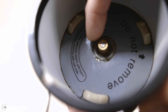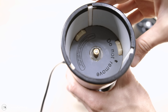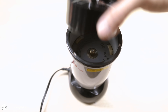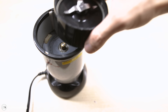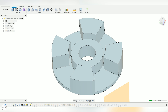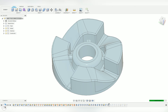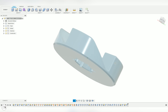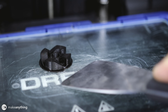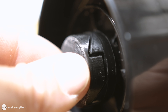Here's the base of the Magic Bullet with the metal piece connected to the motor — there should be a plastic connector around that but it's missing. That piece has to connect to the bottom part in order to lock together and make the blades spin. So after I used my digital caliper to measure that little metal piece as well as the part I want to connect to, I was able to design my own replacement part in Fusion 360. I sent that to my Dremel 3D printer and printed it out using their Eco ABS plastic.